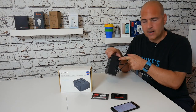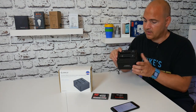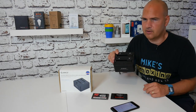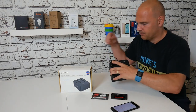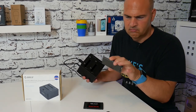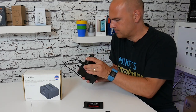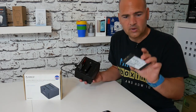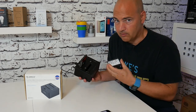It'll transfer data at very quick speeds, or at least we hope it will. Once you've got your discs in, you turn on the power button on the back and then press the start button to begin the process. Then you get to watch the flashing LED lights on the front until they get to 100% and it makes a bleeping noise - at least I think it does, I can't remember, it's been over a year. Anyway, here we go - source drive is our Kingston 120GB. These are SATA III drives, so six gigabits per second total transfer speed.